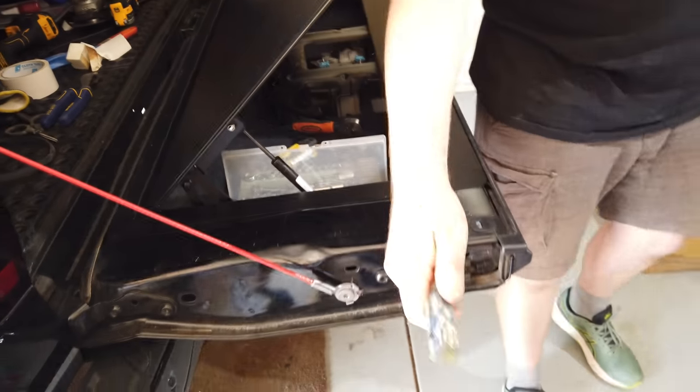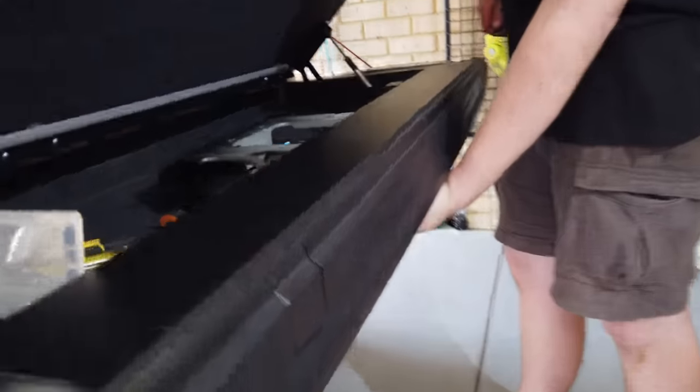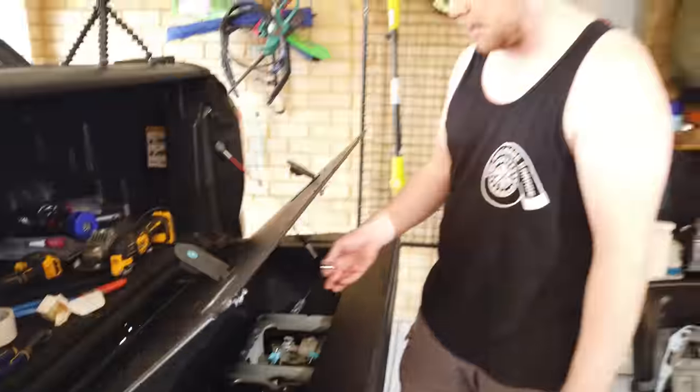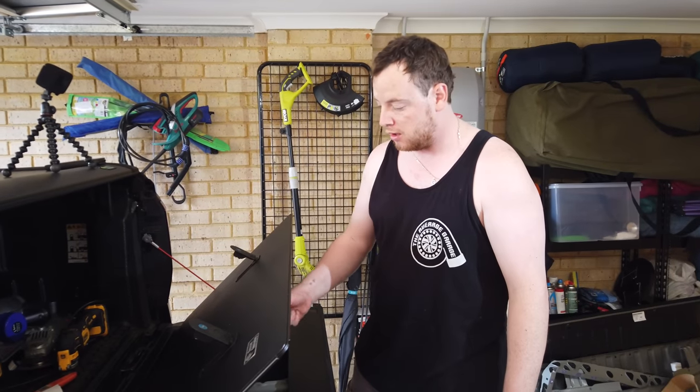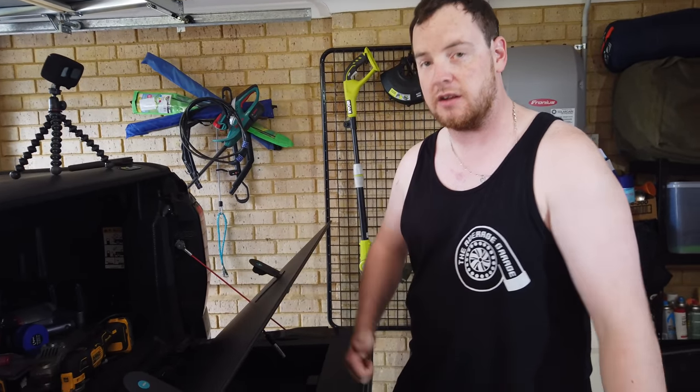And retest. This is all trial and error, and now we can see that's about halfway when it's releasing. So now that we've got where pretty much we need it, we can back the nuts off, put just a dab of Loctite on it, screw them back up, retest them, set.